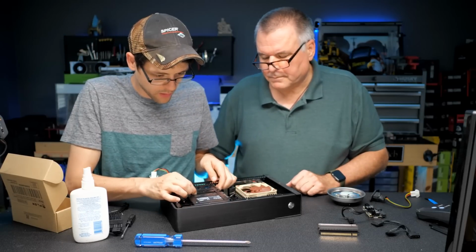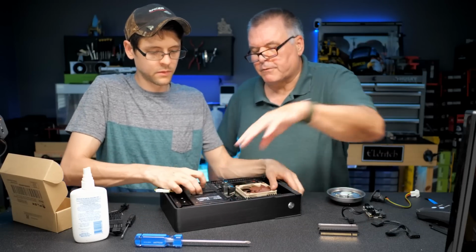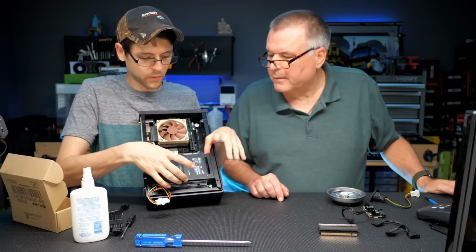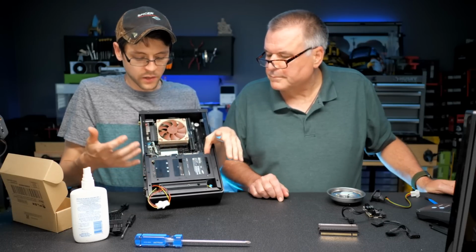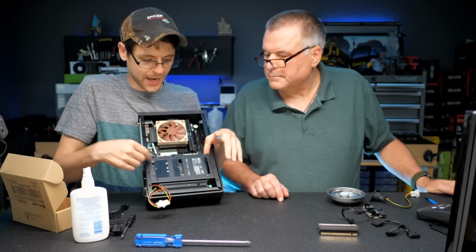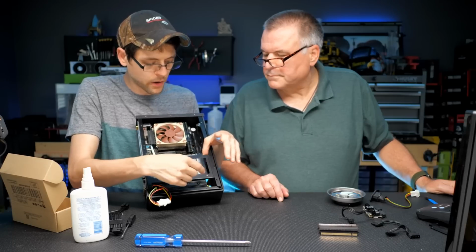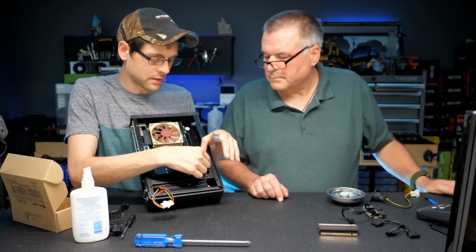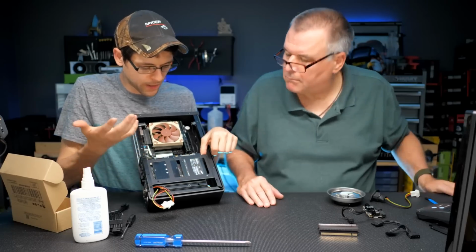For those who can't see from the camera, we're sliding the drive mount back over and it won't clear the power supply. So for the new S4M, there's an extra set of mounting holes. Depending on your configuration, you can mount the Sky Bracket Duo in different places, but there aren't any on the S4M-C. The cleanest thing to do would be to tap this bracket rather than tap this beautiful chassis. So I'm going to mark those two holes, drill them out on the drill press, then tap them for M3. As long as you keep them separate, I think M3 would be better for this application. Is that cool? Okay. And then we'll screw them down, and we'll be back on track.